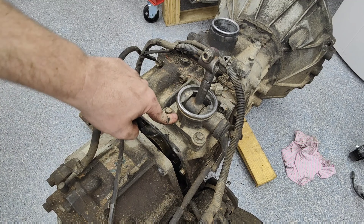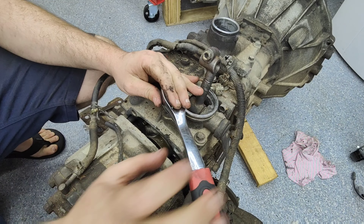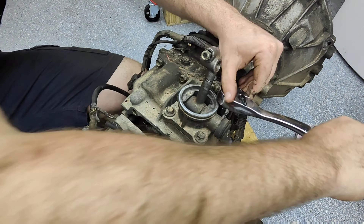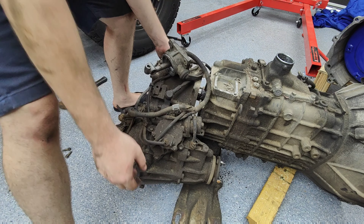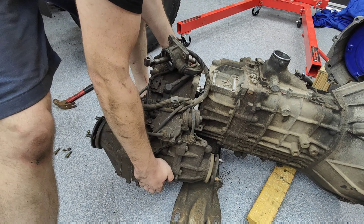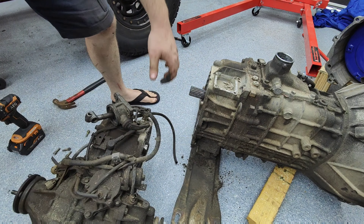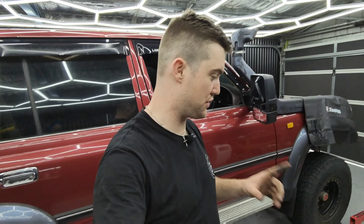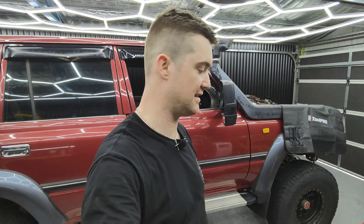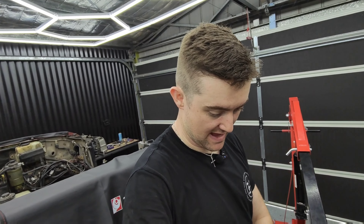It looks like there are four bolts — I believe they're 12 mil on top here with the shifter linkage. Undo them and take this off, and that should come off with it. Once that's off you can just pull this to the side. I can see the spline there now. Using all your strength, you should be able to jiggle this and take that transfer case off. That was actually a lot easier than what I thought. In hindsight, if you aren't doing this yourself, I would probably have removed the transfer case in the car first, dropped that out — it would have given you a much better platform at the front with the crane to get it out. Food for thought: if you're going to do it, take the transfer case out first. It's not that heavy — you can probably catch it on your chest, roll that out, and then do the gearbox separately.